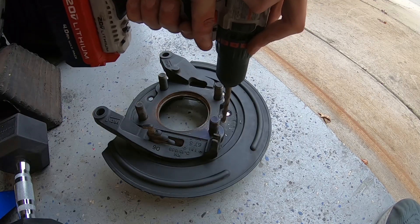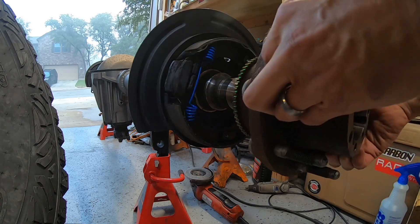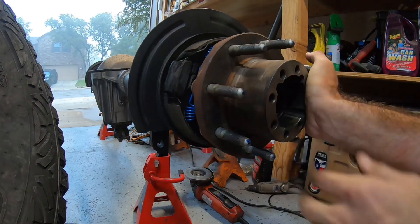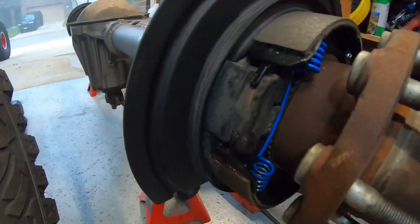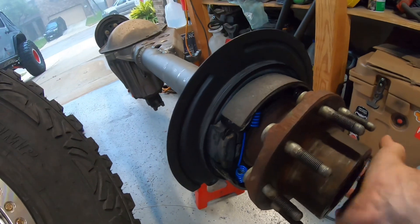After marking it, I start at a quarter inch and work my way up to a three-quarter inch drill bit. At this point, we're going to take our hub bearing assembly with the tone ring, slide it on, and see if it's going to clear all the places we were curious about on the brakes. If you can see down in there, there's not a ton of room around it, but it looks like it's just going to clear. We should be able to put a two-by-four over the end of it, tap it in, and everything should work just fine.